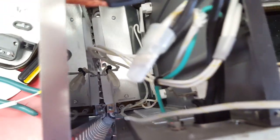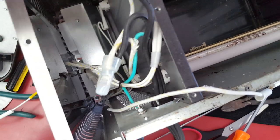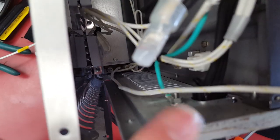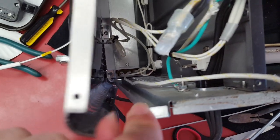I'm going to try and get in there with the screwdriver — I feel like in this case it would help to have really small hands. I considered unscrewing the screw down here that screws into the control panel so I would have more room to pull it out, but then I thought there might be no way to get the screw back in. So I'm going to try and just work with the room that I have. I spent five dollars on the fuse and this is like a $180 toaster, so if I can spare myself from another $180 purchase, I'll be happy. I just hope that this is the actual problem.